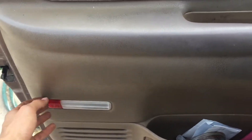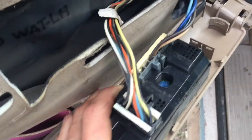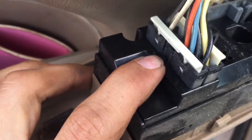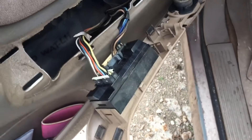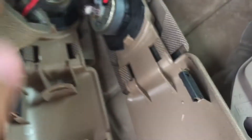You'll disconnect the electrical connectors and then take the panel off. Sometimes it comes out together — just take off the electrical connector in the back. You might need steady hands and a very skinny small flat blade screwdriver. This one doesn't have it — they already took it off. I couldn't get it off from there; all it is is a push tab that you push and pull.